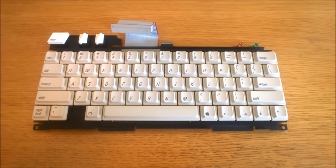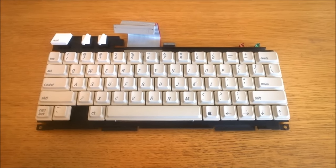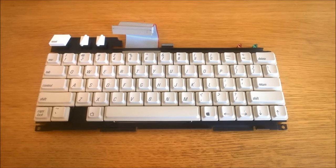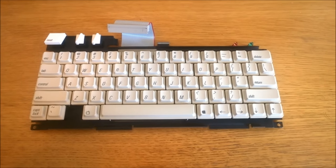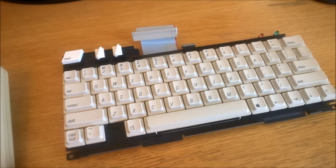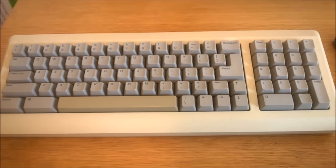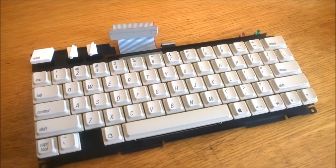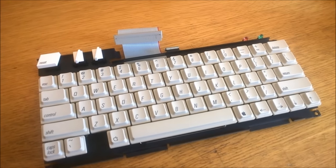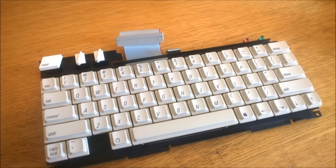Apple used quite a few different manufacturers for their keyboards, and this model originally came with Apple's own hairpin spring switch, which I haven't tried myself, but which seems to be universally acknowledged as being, and I quote, fucking awful. But for the later models, specifically the memory expansion variants, they contracted Alps to make them, who previously also did the keyboards on the original Macintosh and the Macintosh Plus. And Apple really must have liked the results on this because afterwards Alps made just about all of Apple's keyboards, at least the mechanical ones, right until they discontinued the AEK-2 in the mid-90s.